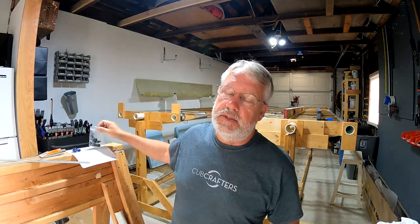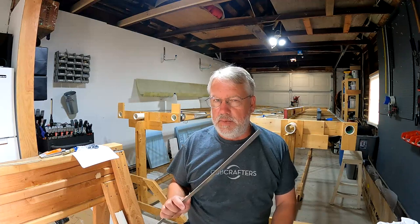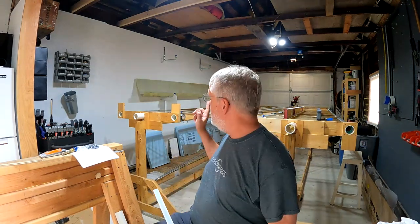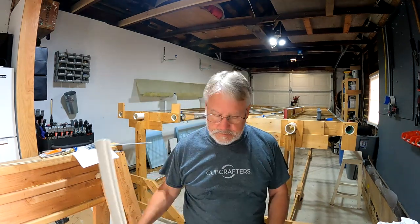I had started working on the aluminum strips which go out at the wing tip end. You rivet and bond them eventually to the underside of the cap strips on rib number 10 and fit the wing tips on. When I started laying those out, I realized it was time to make the decision as to whether I'm doing the Laker leading edge or going with the standard PVC. The winner is the Laker leading edge.